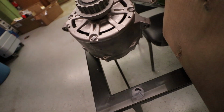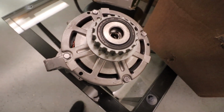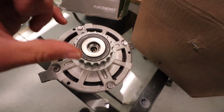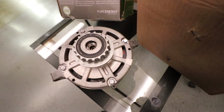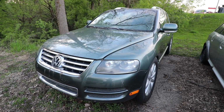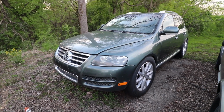It is a water-cooled unit, and this one was a whopping $156 compared to like $900 for the correct one. So we'll give this guy a shot. Next video on the Touareg will be us throwing this guy on. So we'll see if it actually charges. So yeah, obviously we have several electronic issues going on with it. I just want to tackle the alternator first and see what that knocks out.